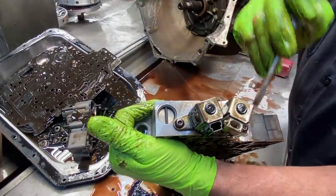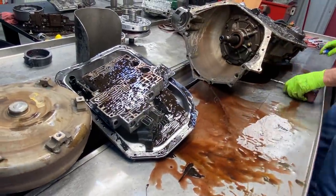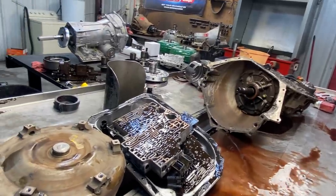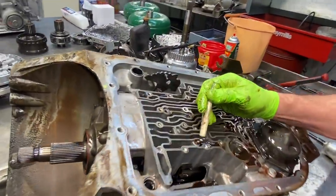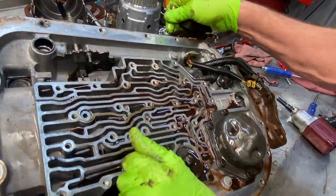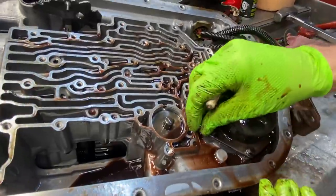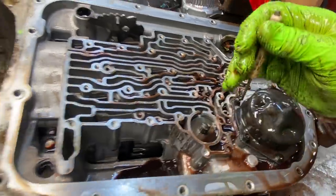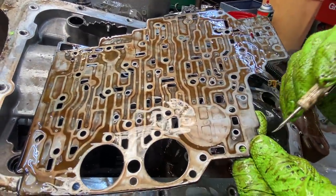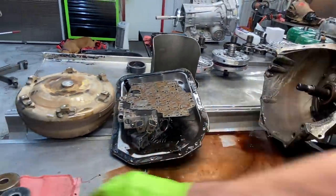You can also see here on your shift cylinder how this has got a short bracket and a long bracket — you can't get them mixed up. We have our check balls here — each one has a nice little spot. But some of these things you've got to be careful. Right down in here there's a place you can put a check ball, and it does not go there. There's a trough where you can put a check ball — it fits right in there, and even the plate has a hole and a bleed orifice beside it, but it does not take a check ball there. Always look at your instructions for check ball locations.